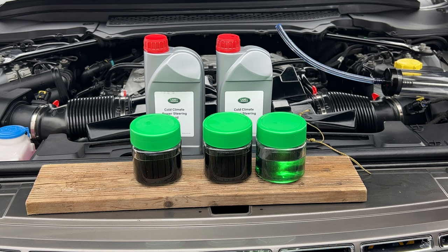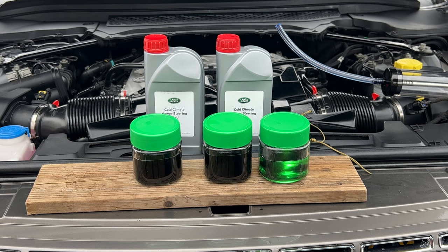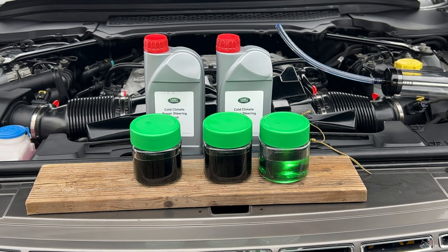That's what flushing the whole system does. People forget — they change the oil and filter but forget power steering fluid. It doesn't last 60,000 miles; as you can see it goes black. Black is from heat; it has to lubricate all the seals in the system. On our cars we do it every 10,000 miles. It's so easy — suck it out, keep topping it up. As simple as that.